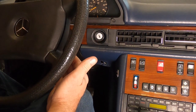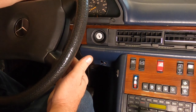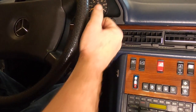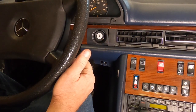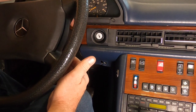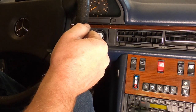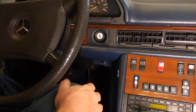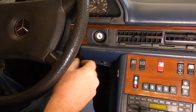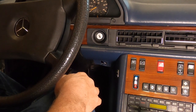So I'm going to make an assumption that maybe there's some debris, maybe there's some worn metal up inside the steering column where the steering lock engages with it. Maybe the steering column is not adjusted properly. I mean, we jiggled it around quite a bit, as you recall, but not a whole lot. And of course, we bolted it back to where it was when we started. There's a little bit of play in these two bolts up here. Maybe I could loosen them and move the steering wheel around a little bit, and that might help the situation. That might free us up a little bit. But I think maybe I'll save that for a vlog video a little later on. But for right now, I think parts one and two of this video series on removing and reinstalling the lock cylinder and removing and reinstalling the steering lock and ignition assemblies, we're going to call this a two-part series, folks.